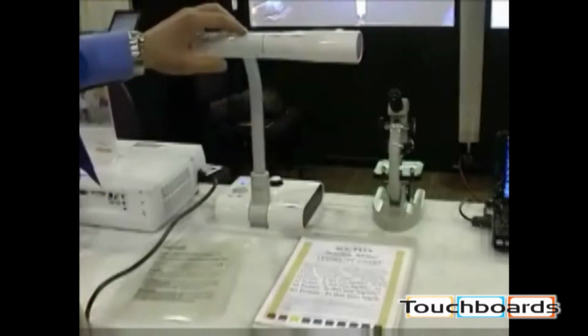Now, let's take a look at what this would look like up on the screen. These previous examples of looking at objects from a different point of view look like this. This is what it would look like as a student camera, and as we spin it around, this is what it would look like as a teacher camera. We're now going to spin it back around into its home position, looking straight down. The black knob on the left side of the camera is for zooming in and out. Towards you zooms the image in. The orange button in the center is your autofocus, which you want to use often. To zoom back out, you turn the knob away from you.